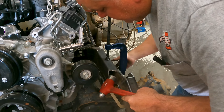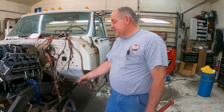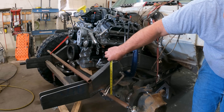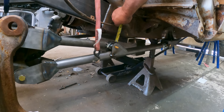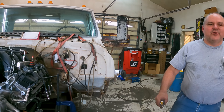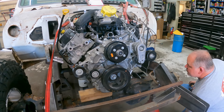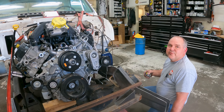There's a nice drop right there - that's where that needs to be. We've got about four inches of clearance there, about four inches of clearance to the tie rod from the frame, about two inches there which translates to roughly four inches, and then about five inches to the oil pan. Four and a half inches - nice. So everything will hit at the same time. Actually that's four and a half, so it'll hit the frame long before it hits the oil pan - which is exactly what I want.